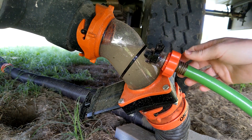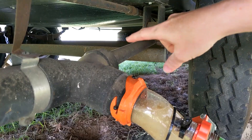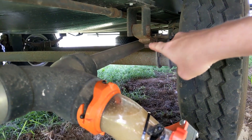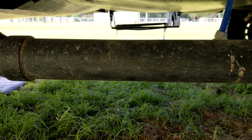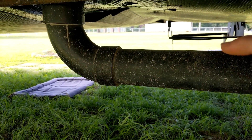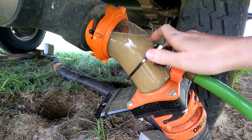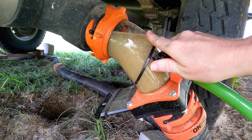When I open this inlet, it's going to start filling water along all of these drain pipes, all the way back up into the RV. It's going to fill this back drain pipe until it meets the closed valve at the back gray water tank, and it's going to fill this front drain pipe until it meets the closed valve at the front gray water tank and the open valve and clog of the black water tank.